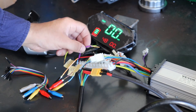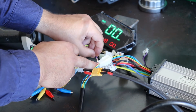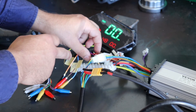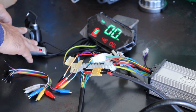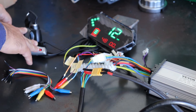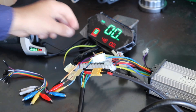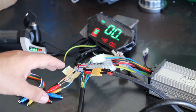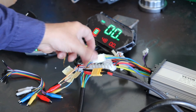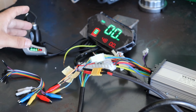Worth noting: this purple phase wire for speed - you can also plug it into the green one and get the same effect. So if I plug that one into the green, it'll read speed off that as well - it's exactly the same. So the purple wire will read the phase speed off either the green or the yellow wire, but it has to be the main ones. It can't be these small ones off the plug. I'm glad we actually got to clear that up.